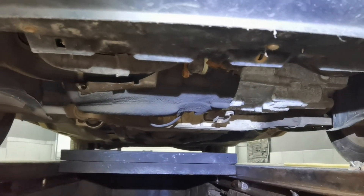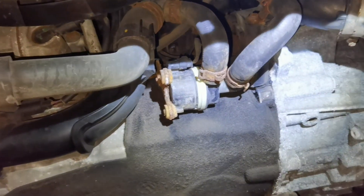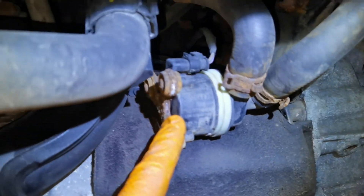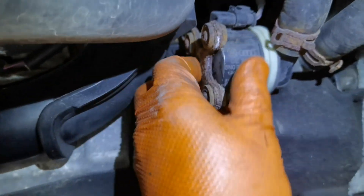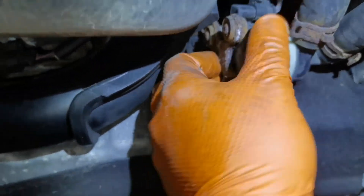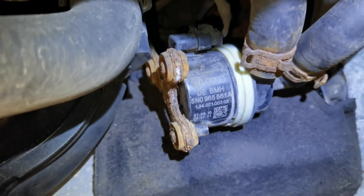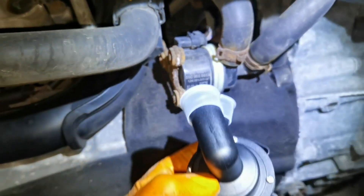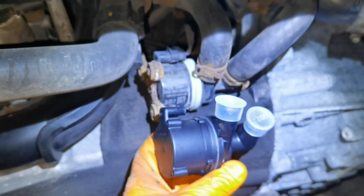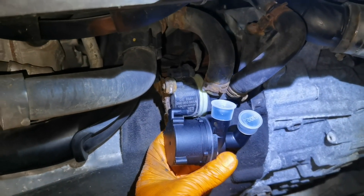The first thing you have to do to replace the water pump on these engines is to go underneath the car. You'll have to remove the under shield and right here is the auxiliary water pump mounted on a 2.0 TDI engine. On a different Volkswagen Group car like Audi, Skoda, or Seat, the auxiliary water pump can be installed in a different place, but in most cases it will be right here in the front of the engine, right behind the radiators. On an Audi, it will have two auxiliary water pumps, so you'll have to check exactly which one is failing.